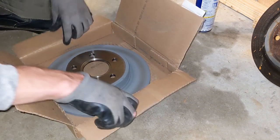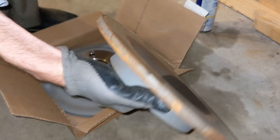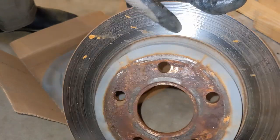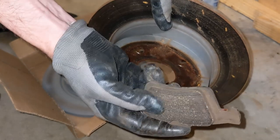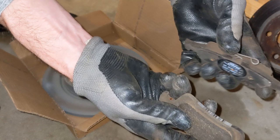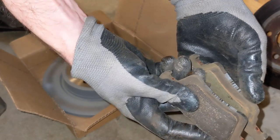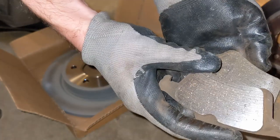It's time to put everything back on, and what I want to show you is actually the reason why I'm changing the rear discs as well. Thickness-wise they're still in pretty good shape with a lot of life left in them, but for some reason this area is kind of grooved — it's not flat. So I'm not sure if that's warping or brake pad wear. Also the brake pad itself — for some reason the front one is deteriorating much, much faster. You can see there's still life on them, but they have different thicknesses. Let me know in the comments if that's something normal or something is not right.